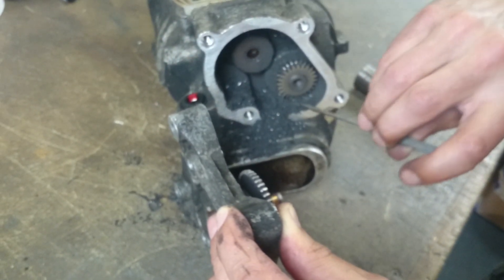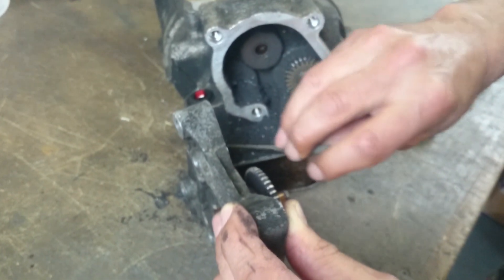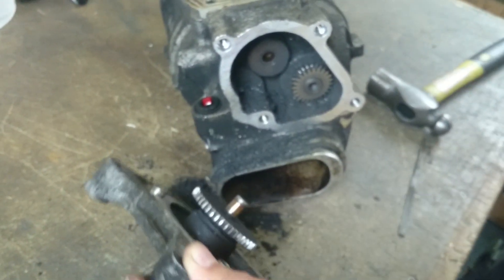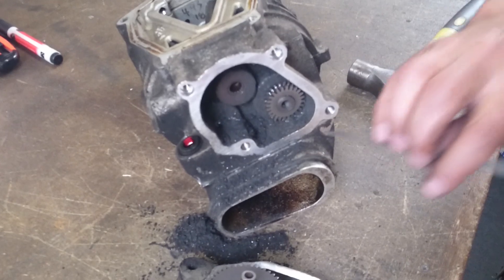That's all there is for today. Do keep an eye on your chargers — if they get noisy, you do need to attend to it sooner rather than later. I think this one's probably only done about 60,000 to 70,000 miles. As you can see, it's a black rotor one, which is the 54 plate onwards. So don't assume because you've got a later car that you won't get the problem.